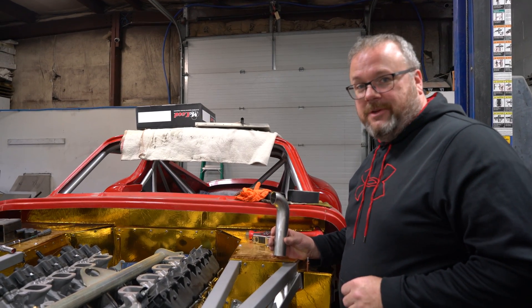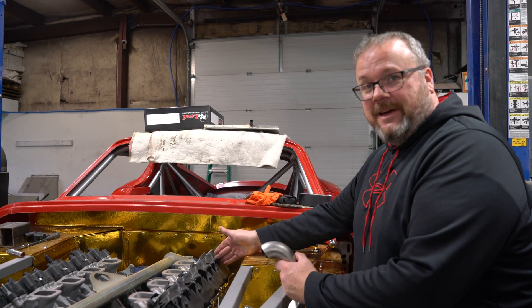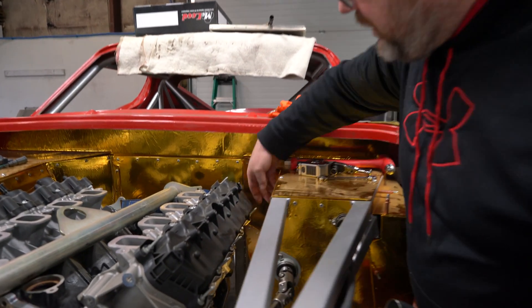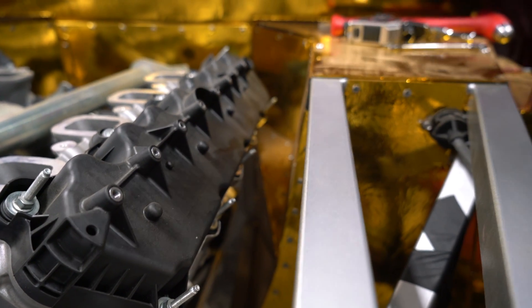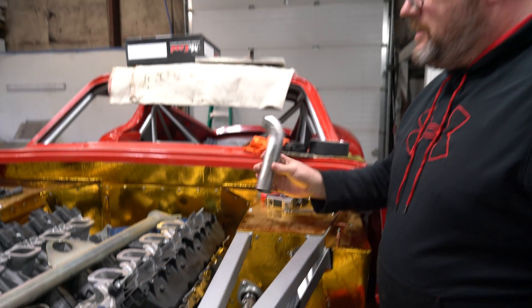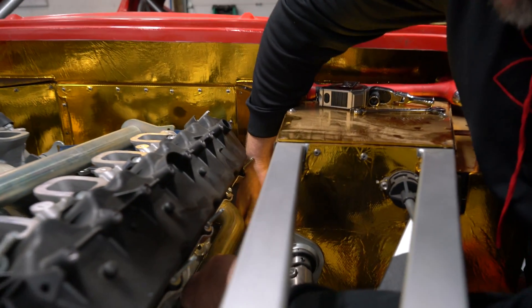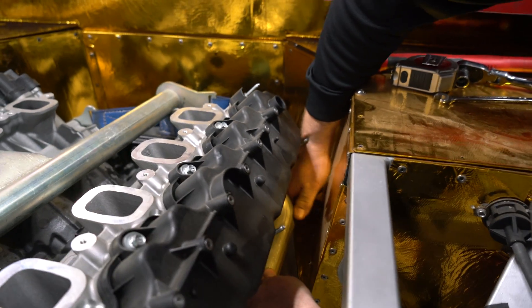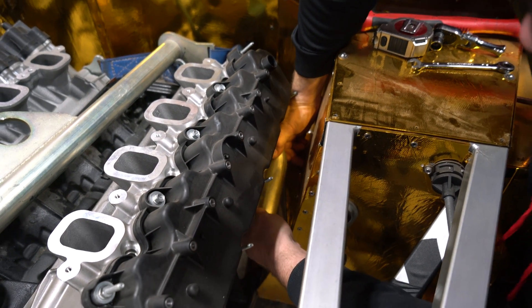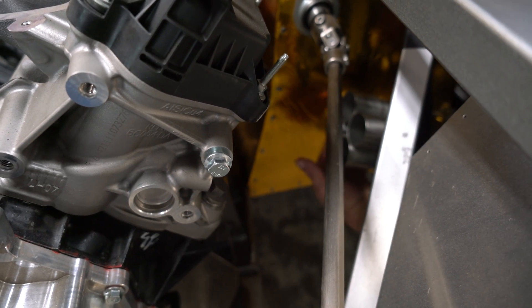On this side we're going to start with the very back cylinder because it's going to be the most difficult — let's get it knocked out of the way. As you can see, we've got roughly four inches right there to work with, maybe five if we're being generous. So we're going to take our tightest 90 from the scrap bend, reach in here, and mock it up and see where we get. We've got to go from there, probably do another 90 — right about there, because that leg is about exactly what I need — and we'll go down into this bottom tube.